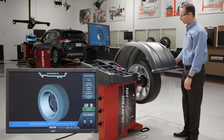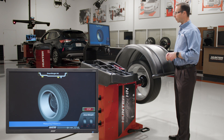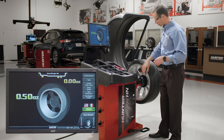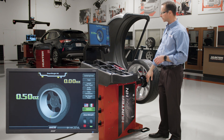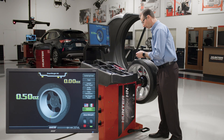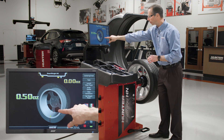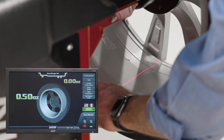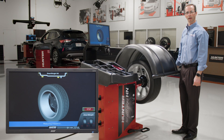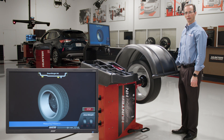I'm going to pull the hood down and it's going to spin the wheel up and measure the imbalance. It says it wants a half ounce of weight, then it servos into place and stops, and it's turned on the laser line to show me exactly where this weight's going to go. In this case it's two quarter-ounce chiclets, and I'm going to place them centered right on that laser line. I'll pull the hood down again to do my check spin, and if I've done everything correctly, the screen will say okay and we'll be finished.